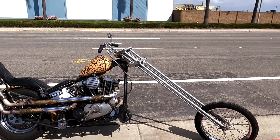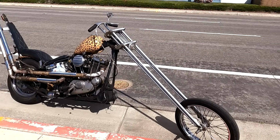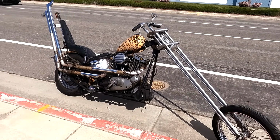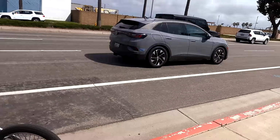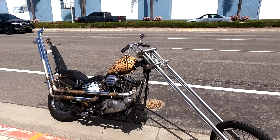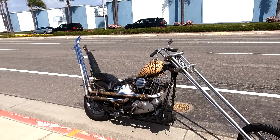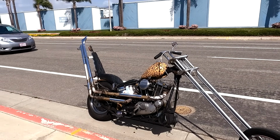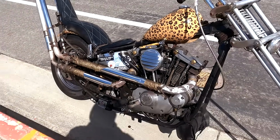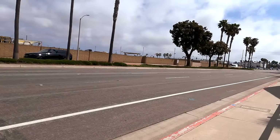All right, guys, so Kade is gonna be here shortly. It just felt like it was working too hard to stay on, so I pulled over, and good thing I did, so I didn't burn anything up. I think before, what happened was it was leaking oil and burning oil a lot because of the valve seals, so it was just blowing smoke, so when I was low I'd keep adding. Now that I haven't added since, there's not enough actually circulating to the motor, so I pulled over, and I think the rescue vehicle should be here soon.